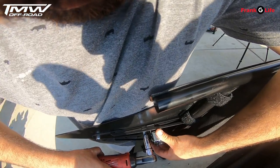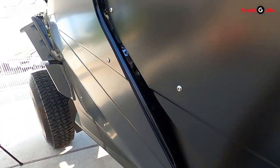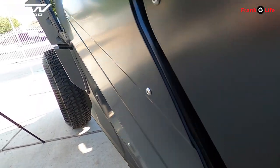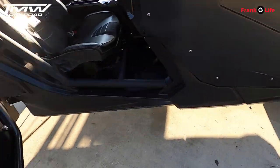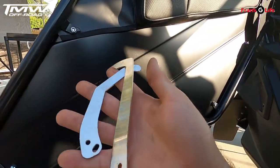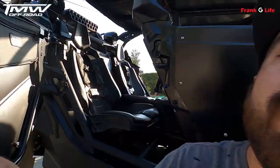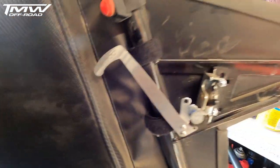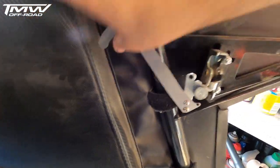That's pretty much all there is to it — let's do the front. To understand why these doors are so good and they don't rattle: you're pretty much hitting the plastic down here before you even get to the latch. You can see that's fully closed — the frame is physically touching the plastics on the body and the latch isn't even closed yet. So when you do close the latch, it's putting constant force on the bottom of the door, keeping it nice and tight. Before we go, I'm just going to show you guys real quick the handles that it comes with — these are just stamped pieces of stainless steel that go in here like that. What you're going to have to do is drill this out, pull the strap off, and bolt these in.